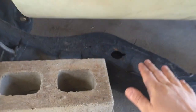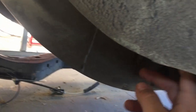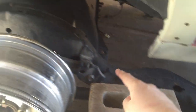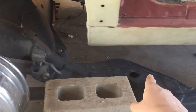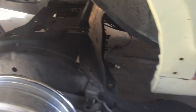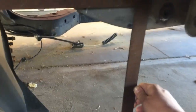What I was just realizing is how I'm going to reference the height change to know how far I have to go up into here. What I'm going to do is run a straight edge on the bottom of the rocker panel right here coming straight out, and then measure the difference between the top of this and the height of that — so I know that wherever the bottom of this resides, if it's say eight inches taller than where the top of the frame is going to sit, I need to go eight inches up from there. So using the square — it's basically on the highest point of this rear end hump on the bottom of the torque box — and it's right up against the lowest point of the frame, and that's about 14 inches.